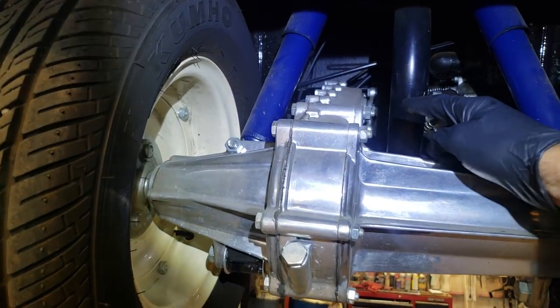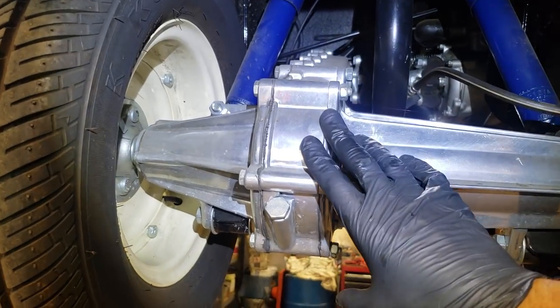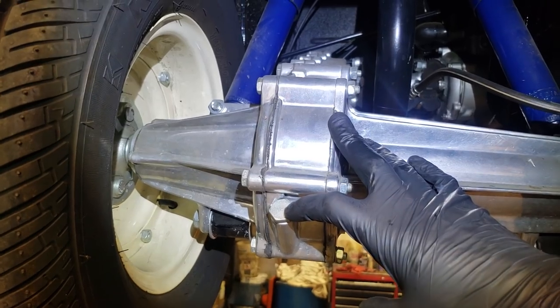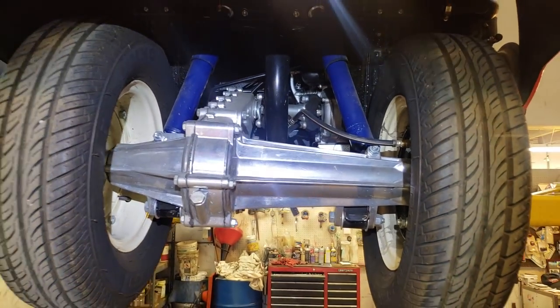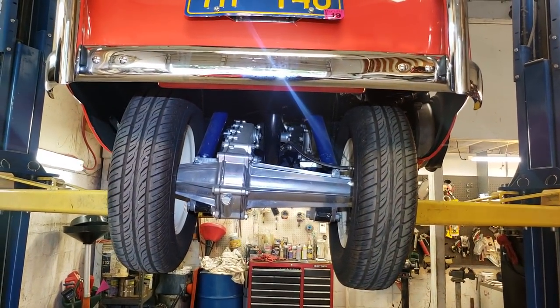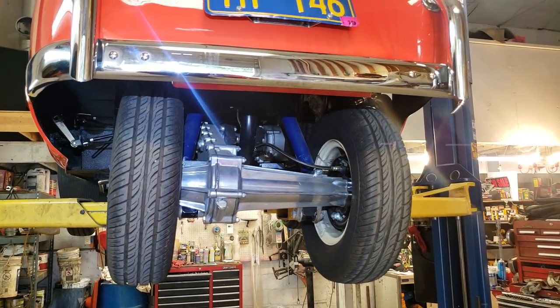The chain which comes from the engine comes around a gear which is in an enclosed case. This is the oil level — it's how you check the oil for the chain case. It's a solid rear end. Partly why the two tires are so close together is that when you go around corners, the differential action doesn't need to come into play.